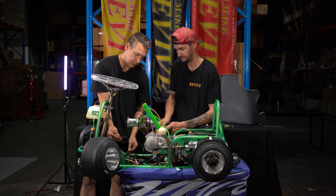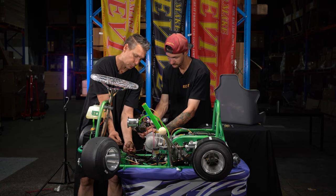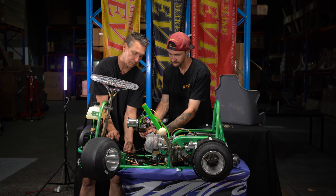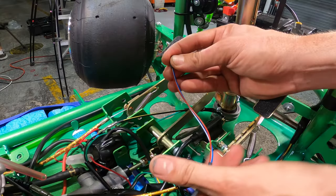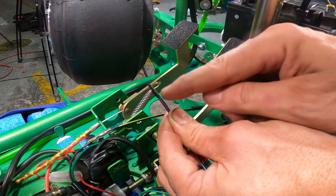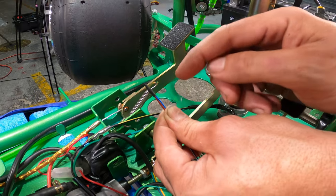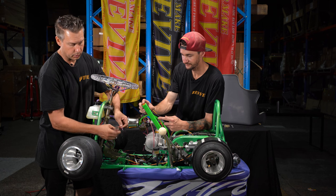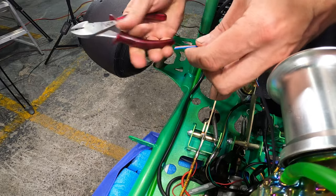We then have these two wires that are together. There is a red and a blue with white trace. If you want to have the taillights actuate on both the brake pedal and the hydraulic handbrake, both of these get kept together. We're going to bare the end of these and we're going to place a male bullet terminal on the end of these two wires. Let's do that now. So we're going to strip that blue wire with the white trace and the red wire together. So I'm gonna cut that off,